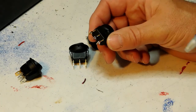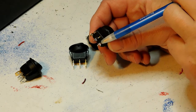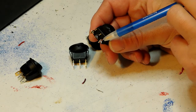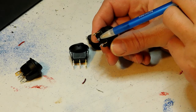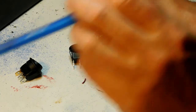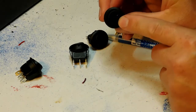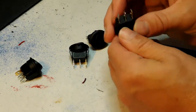The wire coming from the power source — either from the battery or the power supply — your hot wire or positive wire is going to go to the outside silver terminal. Now whatever you want to switch — your amplifier, your radio, whatever — you're going to come off the center terminal. That's called your load, and that goes to whatever device you want to switch. So when you flip the switch, the LED is going to come on and it's going to switch your device.